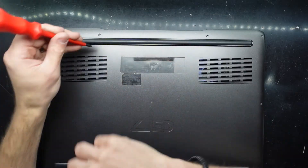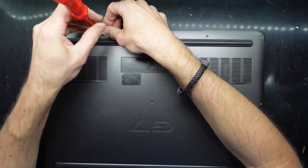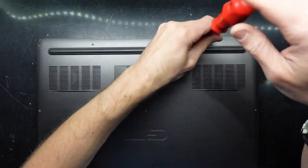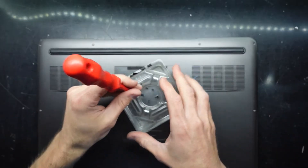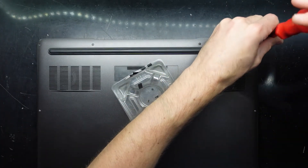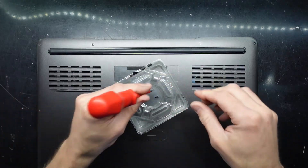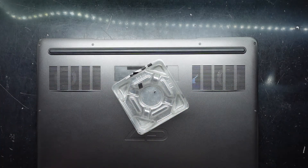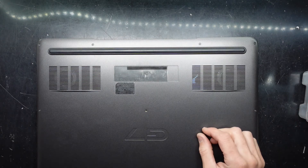You may have to do those two back screws first. The rest of the screws are pretty much the same length. If I have to leave screws out, I usually leave the ones in the middle and focus on the outer edges — try to have one in every corner if you're missing quite a lot. And that's how to replace the thermal paste on a Dell G7. While we're there we looked at the RAM and other upgrade options. Hope this helps, and I'll see you guys in another video. Bye.